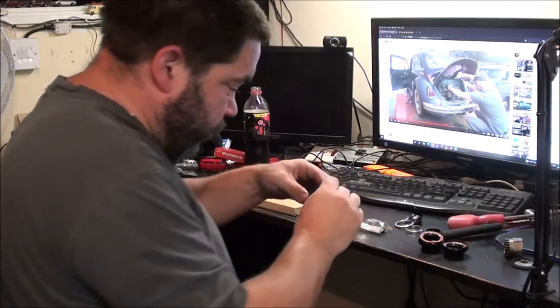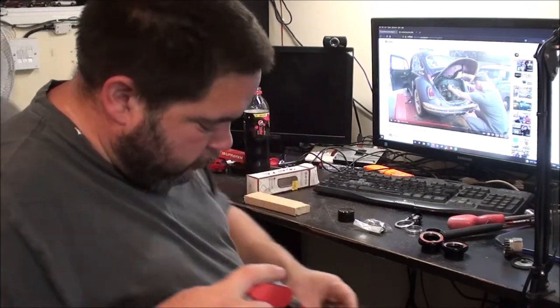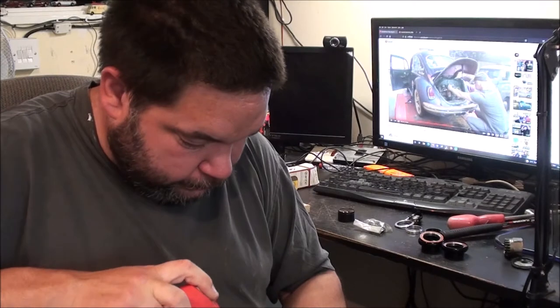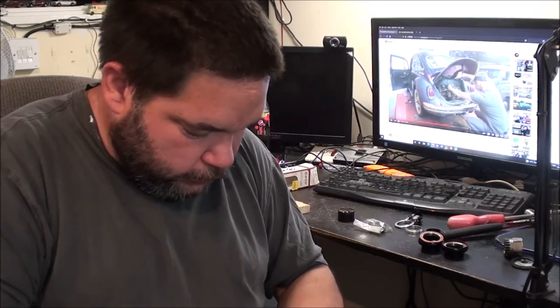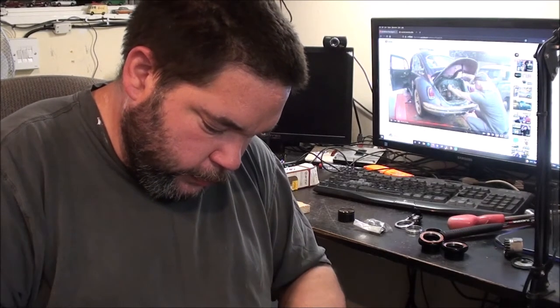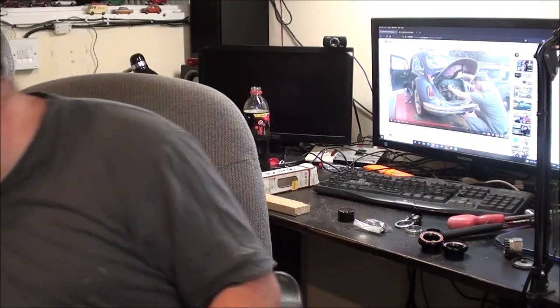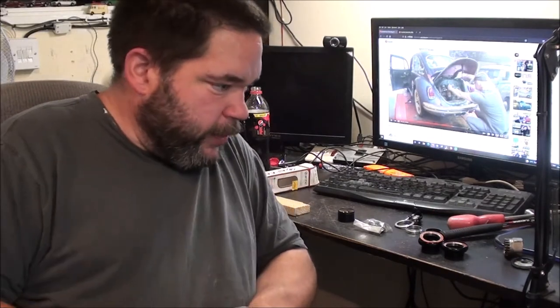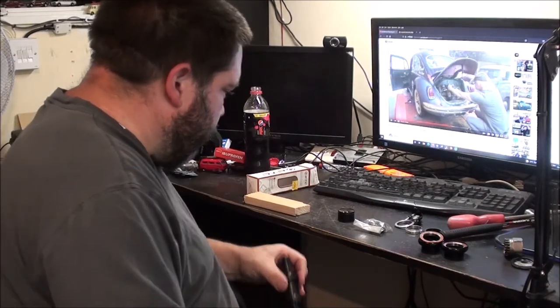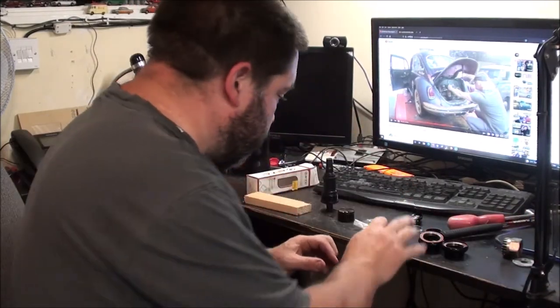Now, the bottom bracket I got, I'm going to spray that with a bit of WD because it's a bit grungy on this side, but I think it's just been on the shelf for a while. That's a bit better. Now my fingers are slipping because they won't grip it. Anyway, this was cheap, so I'm not that worried about it. It did have one thing missing from the box, which was the lock ring. It goes around the other side, but I've got one off the old one anyway, so it doesn't matter.